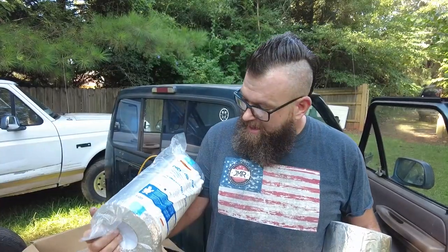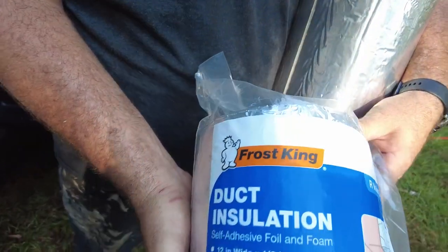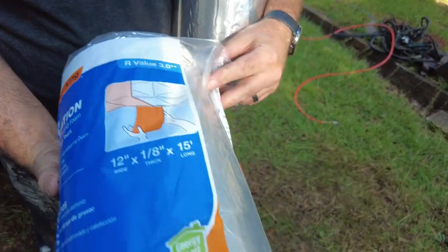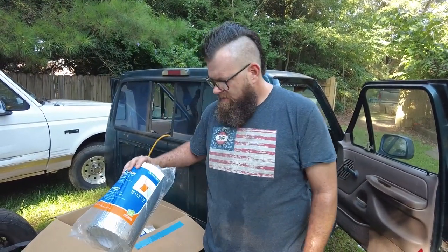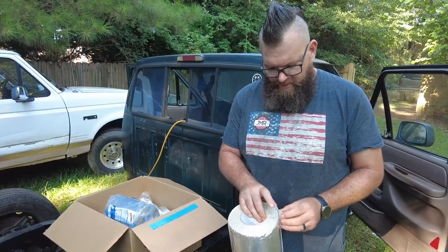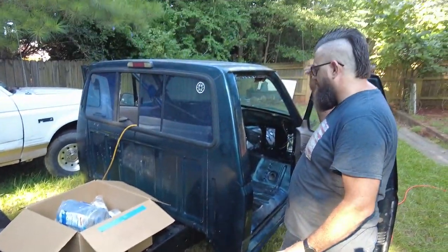So what we got here is how we're gonna sound deaden this truck. This stuff you can buy on Amazon — it's called Frost King from Home Depot. We'll put a link in the description below. It's literally an eighth of an inch thinner than Dynamat. Now Dynamat will come in a bigger, wider roll, so it's a little more. This one says 15 feet. It's actually less than an eighth of an inch. See that's the thickness there. And it is sticky on the side, so you roll it out, put it where you want it, cut it, and keep on rolling.